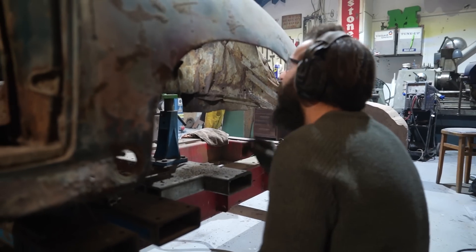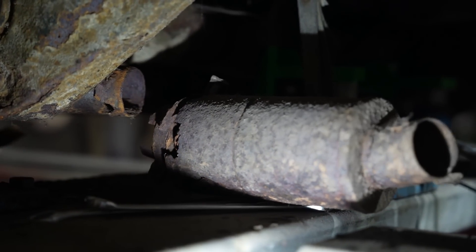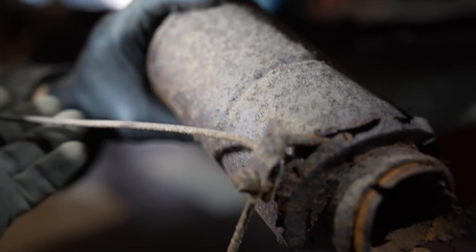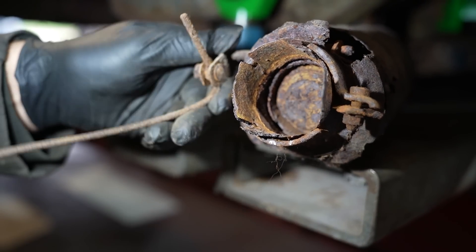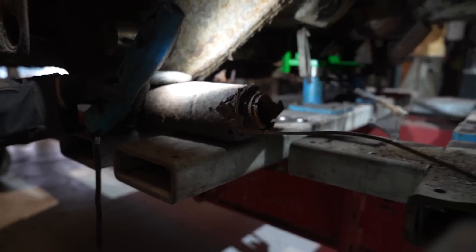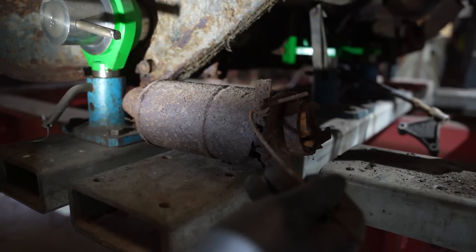That's got it. There's the heat exchanger tube removed. It's definitely a dry state motor. What's that cable? That's the heater control rod — it would have gone from that to the flapper box on the engine. Open, shut — so this would go to the heat exchanger or the flapper box as they call it. You'd have a cable coming from the other side of the flapper box back to the car, so when you turn the knob inside it would operate this, opening the flapper box at both ends simultaneously.